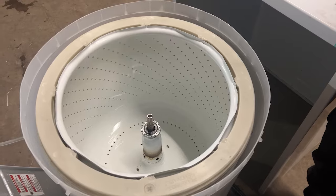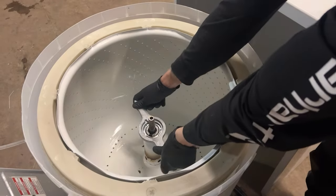Now this next part with the spanner nut, you're going to need a special tool to remove this nut. That spanner nut is extremely difficult to get off. You'll see people who try to hit it with a hammer and end up chipping that nut and having to replace it. The best thing to do is to use a spanner wrench like you see here. This is a TB123A, a notorious spanner nut wrench in the appliance industry.